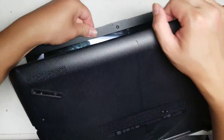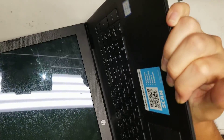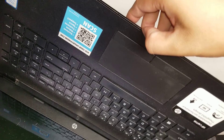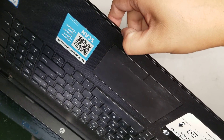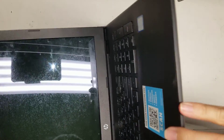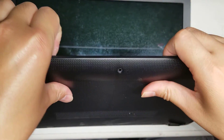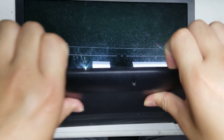I like to have the screen open slightly. This one actually had the hinges break and I had to epoxy them together. But basically to get the cover off, you get your fingernail between this layer and the palm rest. I use my fingernails to dig into the gap and then push with my thumb on the back — that's how you pop the cover out.